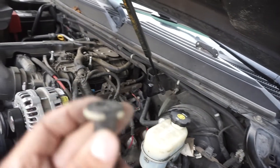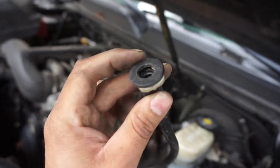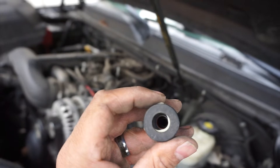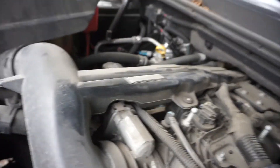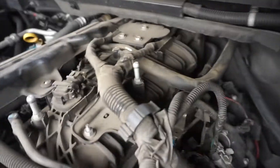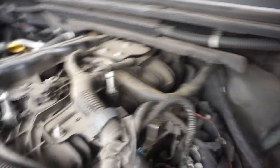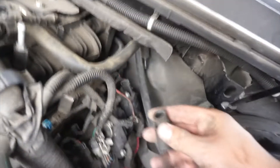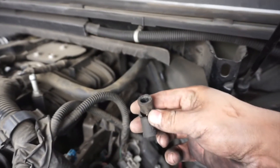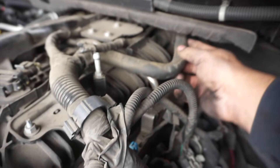On the other end, put your fingers in there — you can't really see because it's in the back, but you push your fingers so this lines out, you can't see the white inside. When you put it back on you lock it, and that's how it locks where you can see the white. It does have a little pressure release. I did have to remove the PCV valve vent hose, which is right here. Follow this hose all the way to the bottom — it's connected to the corner back there where that little metal piece shines and there's a little elbow. Mine broke; it's old, it's brittle. We'll have to replace that too — looks like it's a 3/8. Once you get the hose out of the way you just push it to the back so it's not in your way.